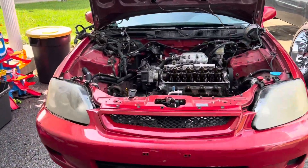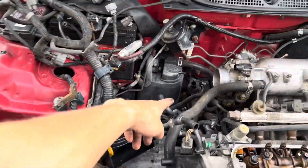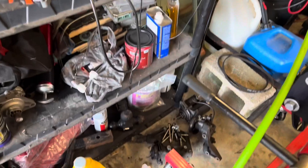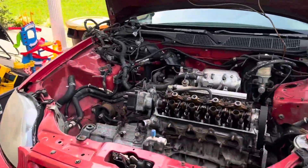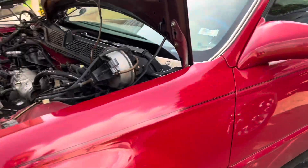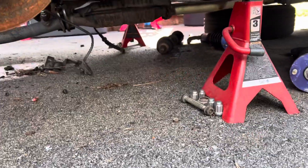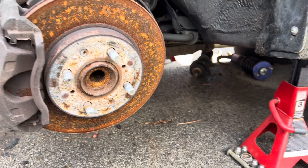Swap is officially in, completely bolted up by all four mounts — torque mount, trans mount, T-bracket mount, and hoist mount. Still got that other torque mount over here as well as the bracket and all that. We've got all that put on. Still got to fish the engine harness around through and get all that plugged up — that's the easy stuff. Then after we get all that done we'll focus on getting the suspension stuff back together, the axles, and the shift linkage for the shifter.